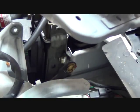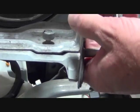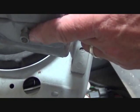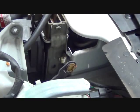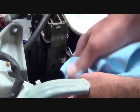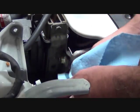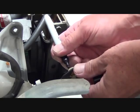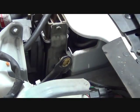At this time, we can also remove the stop here on the headlight assembly side — 10 millimeter lock nut. We're going to loosen that and then this will just thread out. We want to mark the activator rod, so I'm going to clean it off and take a permanent marker — marking the headlight side of it with a Sharpie, so I know that's the headlight side. Then I'm going to pop the activator side loose. Now we have the activator removed with our marked end.